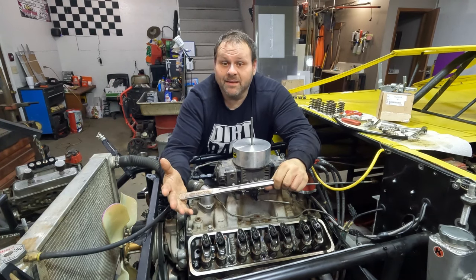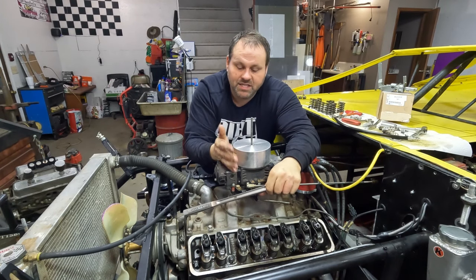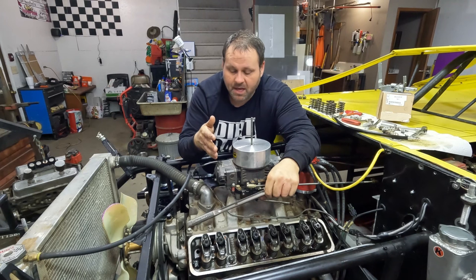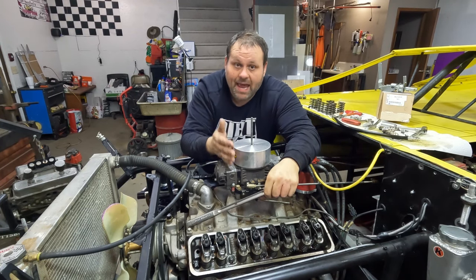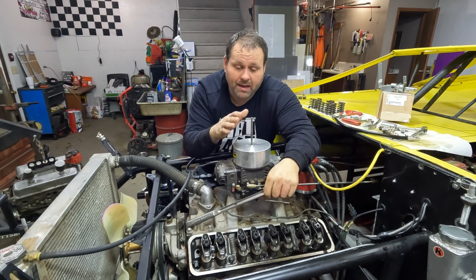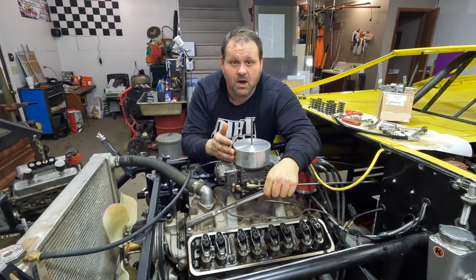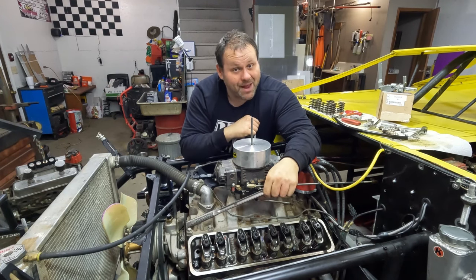What else, Dylan? The preload on the valve springs. Mr. Robert Hughes is the builder of this 602 — he's a certified engine builder. He told us to set the spark plugs to 45 thousandths, which we did; we're going exactly by his numbers. And I normally had done a quarter turn of preload on the hydraulic lifters, but I'm running racing engines, not 602s. Mr. Robert said he wants a half turn to three-quarters of a turn on the 602 for preload, so we took all of these up to a half turn. If you've got one of these 602s or 604s and you've got a certified builder, however they're tuning it and dynoing it, they are the experts. I'm strictly going by that guidance to get the best out of this particular engine. Hope it's a good one and Dylan wins more races this year. See y'all next time — we've got brake lines to put on our street stock.